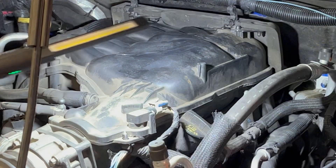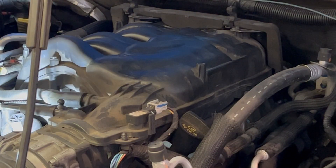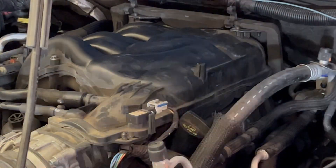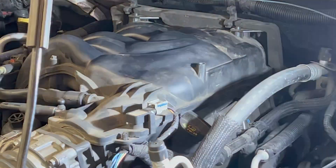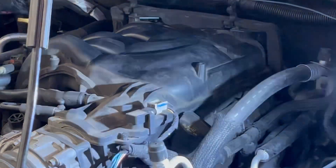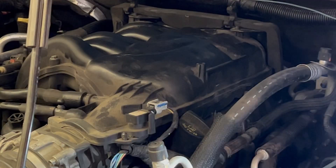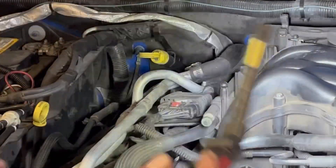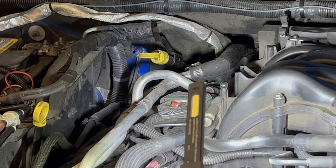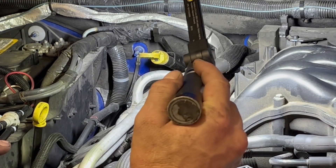The injector is under the intake - way back there. There's no way I'm going to get in there with the leads. The ECM is right here, so we're just going to back-probe at the ECM. This engine was just replaced, I guess just a few months ago.